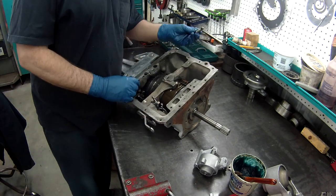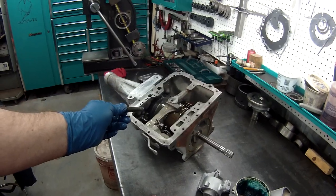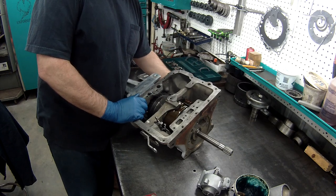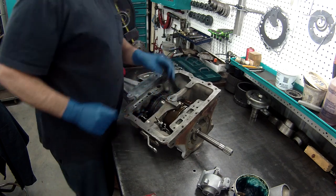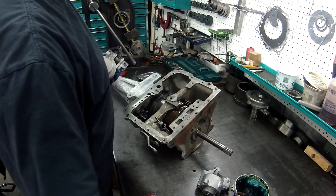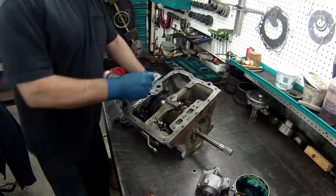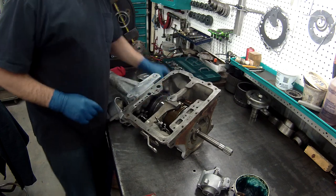Now the rear band, start with the pin. Let me readjust this a little bit. We want to put our adjusting pin or adjusting bolt on the outside and screw it in so it just barely comes through. On this one, we have this and this. We'll get this so it's sitting on top of our adjusting bolt. Slide the band into place.